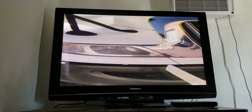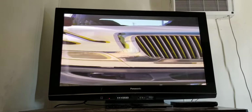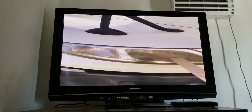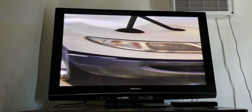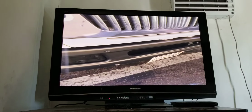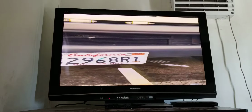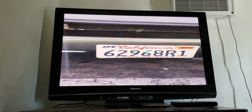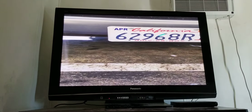Coming down, I have my headlights, my high and low beams, my right turn signal, my left turn signal, and my four-way flashers. They're properly mounted, no loose or missing screws, no cracks, no missing bulbs, amber and clear in color, working properly. Next, I have my bumper. It's properly mounted, no loose or missing bolts, no bends, cracks, or any illegal welds, and no extra holes. I have my license plate. It's properly mounted, no loose or missing screws, clean, current registration, present, and visible. Underneath the truck, I'll be checking for any oil leaks or contamination of any kind.